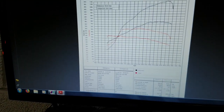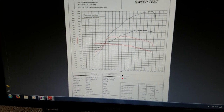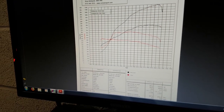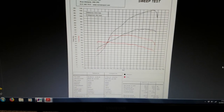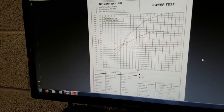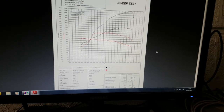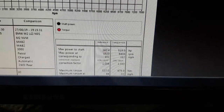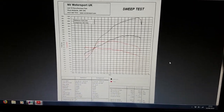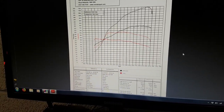Double nozzle has made a massive difference. Although intake temperatures aren't that high today — creeping up to about 30 degrees — we're looking for fuel film which is what the water does. The additional nozzle thanks to Matt has enabled us to hit 519 brake horsepower and 676 newton meters. The good thing is this still maintains good fuel pressure on the high pressure fuel pump, so we can add a bit more.